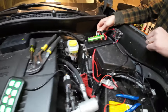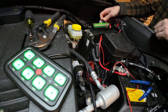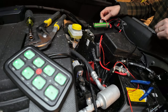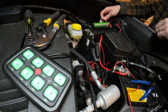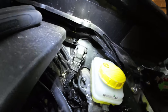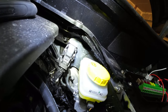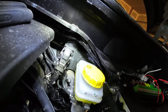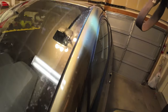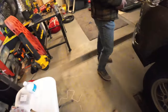Small correction: you tap the white wire to positive to cycle through the brightnesses. At night, anything but the lowest brightness level is extremely bright, but luckily it has a memory so you can set it to dim and leave it there. To pass the control wires into the cabin, we're going to use this empty grommet — it says 'SJ' and it's a vertical oval, and it pops out just above the pedals in the driver's footwell. We'll put a hole in it approximately the size of this control panel wire, run it up the A-pillar, across the top, and have the control box in the sunglass holder.